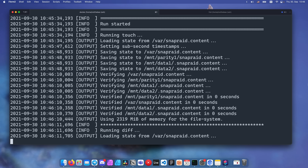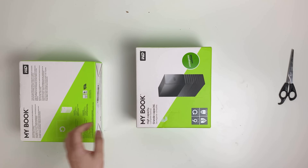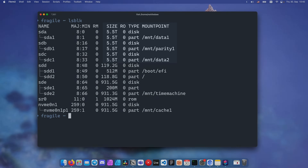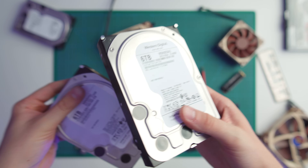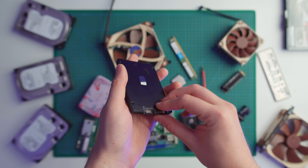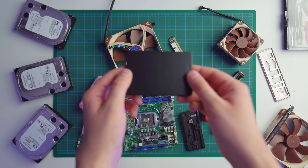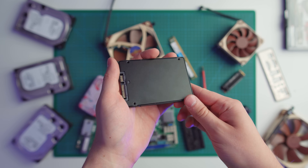If you're going to be using MergerFS and SnapRAID like me, you don't have to buy all drives the same size or all at once. You can start with just one or two drives and gradually buy more as time goes on. The one thing to consider is that your parity drive — the one storing SnapRAID data — should be as large as your biggest data drive. In my case, I got three 6TB SMR drives for backup and media storage, and also a 1TB SSD for Time Machine backups — pulled from a SanDisk Extreme and stuck into an M.2-to-SATA adapter. I've also got a 128GB SATA SSD as my boot drive; it's the same one from my first NAS build and still works fine.